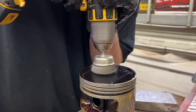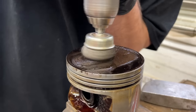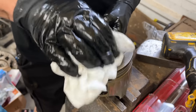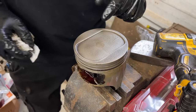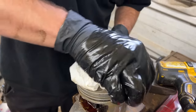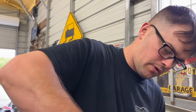That wire brush did it — that is incredible. I couldn't get that hardly off at all. One thing you do not want with your piston tops or combustion chambers is sometimes they'll leave like a little casting flash somewhere and there's like a little sharp point sticking up — it will cause detonation because it creates a hot spot in the cylinder. So you want to have smooth piston tops and smooth combustion chambers. No sharp points.